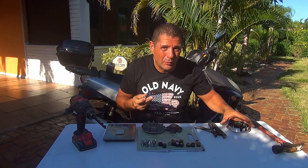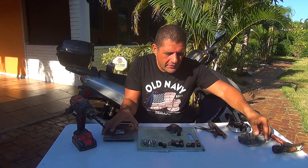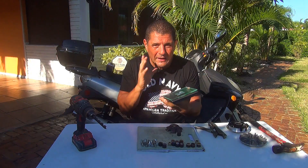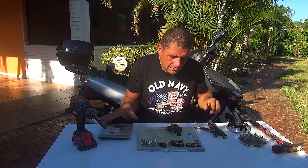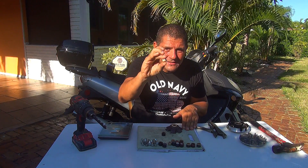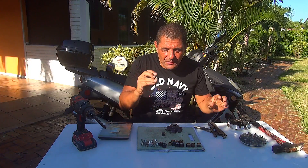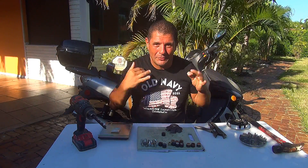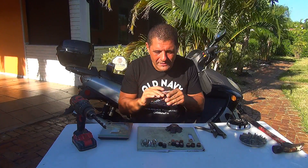You need a starting point — you need to know what weight you currently have on your scooter. Get a scale, which you can buy anywhere online, and weigh your roller weights in grams. You may also have sliders instead of rollers; sliders slide rather than roll when the variator opens. I'm not a big fan of sliders — I prefer roller weights.